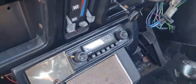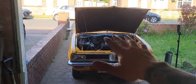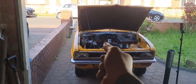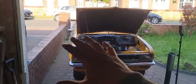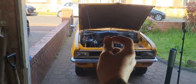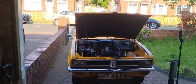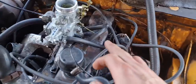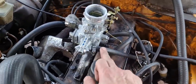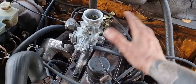To sum it up: the choke cable is not working and it seems like it's massively over-revving with the Weber, even though I backed off the accelerator and put the idle mixture screw all the way in. It was also revving up and down a little bit. Could the straight rubber hose from the fuel pump to the carb have anything to do with it? There's got to be a fix. Let's read the books.